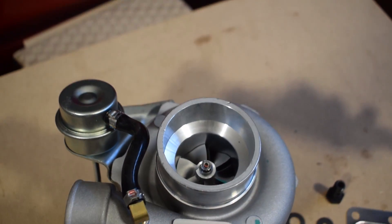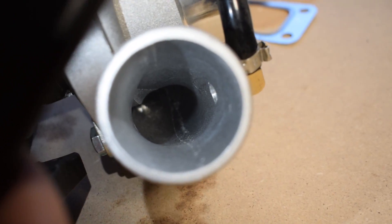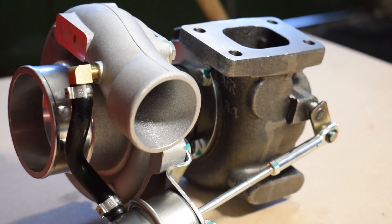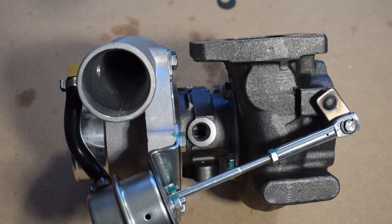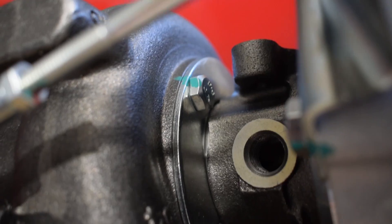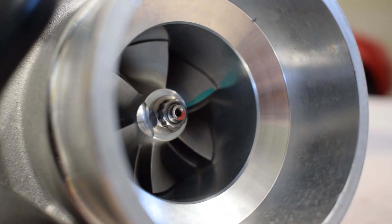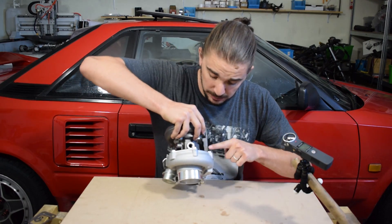The castings look really nice. There's nothing wrong with either the hot or the cold side — no weird or concerning casting flash anywhere that I can see. The machining looks pretty nice as well, very tidy and decent. There are no rough sharp edges anywhere, and the threads for the bolts look very clean too. There are also signs of quality control: paint markings on both the turbine wheel and the compressor wheel, and paint markings on all the bolts on the housings.